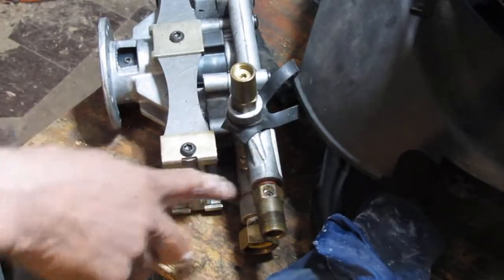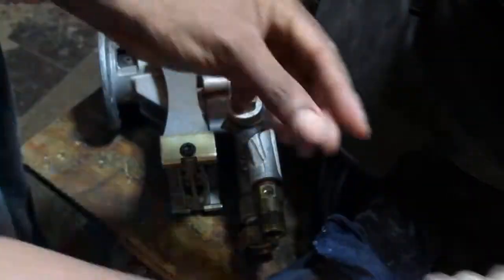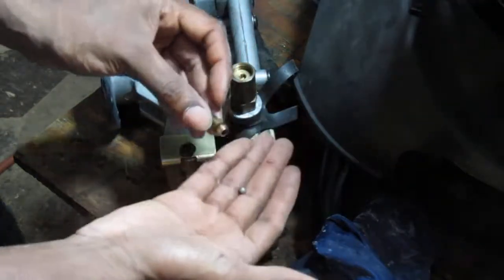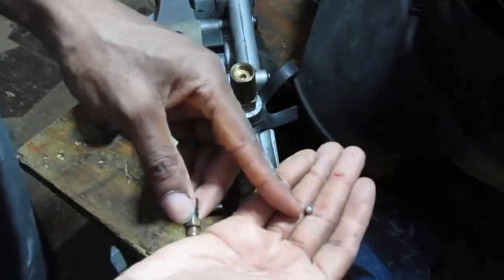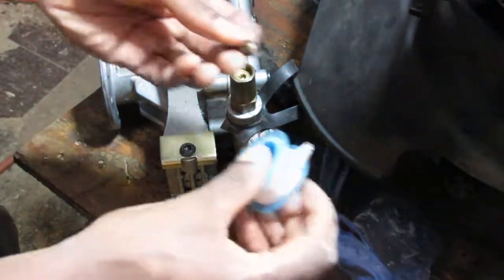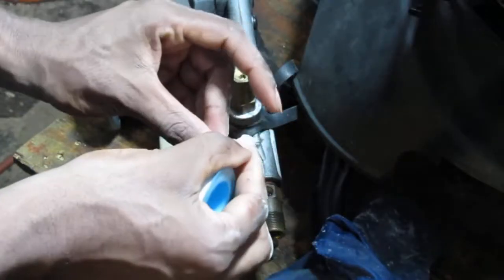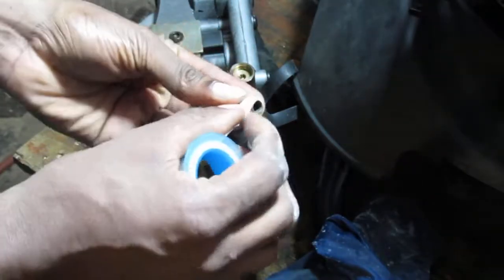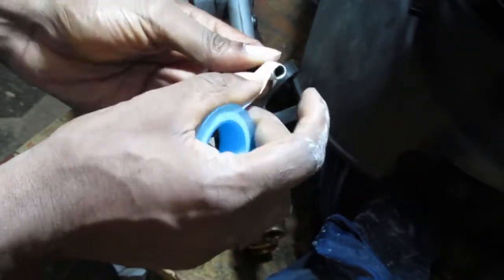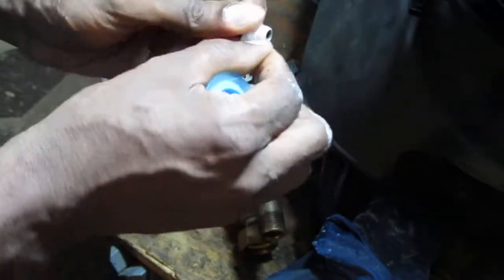So that is definitely the chemical injector that we're gonna put back in, and it does have a specific order to it. The bearing goes in first, and then the spring. So what we're gonna do is just get some Teflon tape around this, since it's probably never been removed ever. There's no reason to ever remove it.